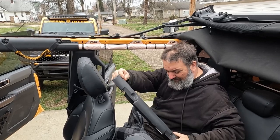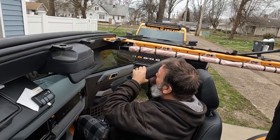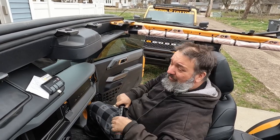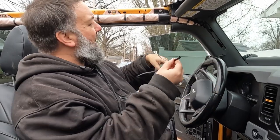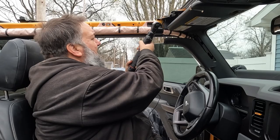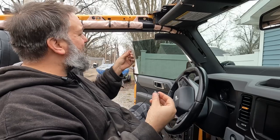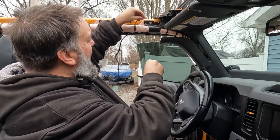We'll take the back off first because that covers the front, and then we can take that off. That just comes right off, and same thing with the front panel. Pop that piece out. Now do the same thing on the driver's side. Next step is take this small wiring harness and connect this ground to this bolt right here — it's another eight millimeter. You are working around the airbag, so it's a good idea to disconnect the negative ground from your battery.